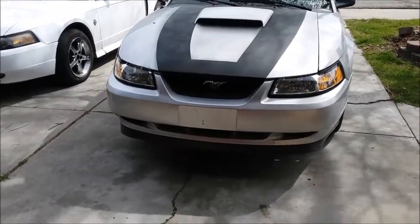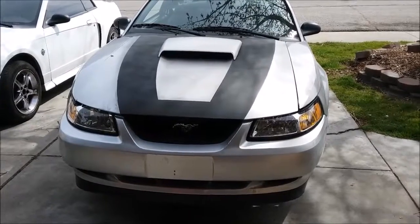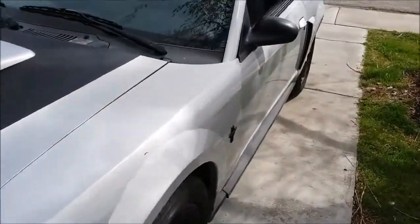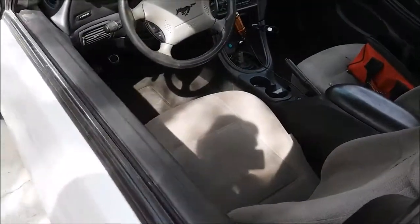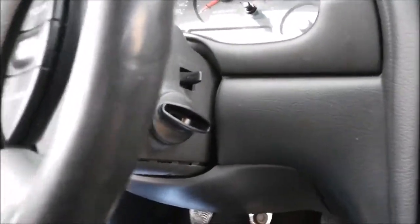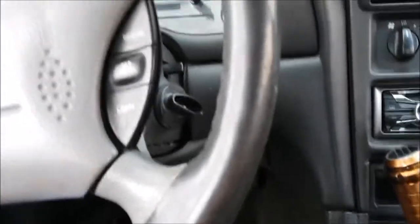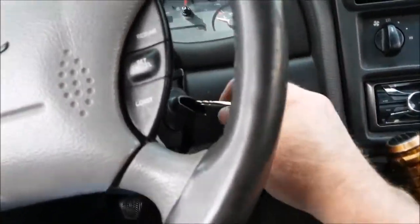How's it going everybody? Got the Y2K Stang — a little project I got to do, try to do on video for you guys. I've got the warning chime on my car not working right. The chime comes on — I shouldn't be doing that because the key's not in there. Key's not in the ignition but it goes off when I shut the door. My suspicion is there's something going on with that ignition in the wiring somewhere.